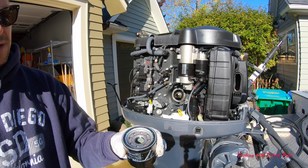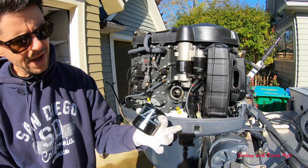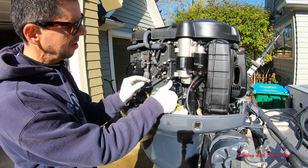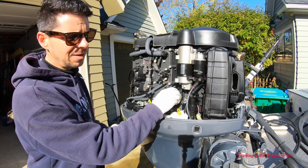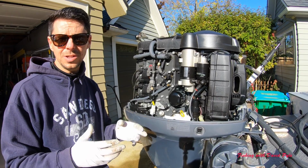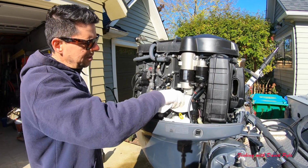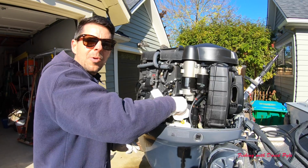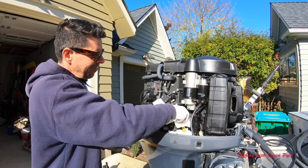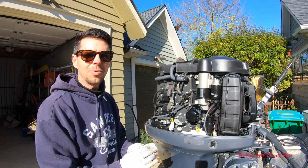it has a little plastic on it, and make sure that you've got some oil around that edge, even though it's got probably some petroleum product on it. I'm going to spin that back on, and I go hand tight with this, because even though every year I go hand tight, by the end of the season that's on there, it's really difficult to get off. So paper towel around it, turn hand tight, and once I start my motors up, obviously I'll verify that this is not leaking. So that's about as tight as I want to go. Clean up my little mess, and then we'll be on to the next task.